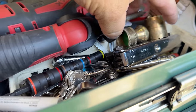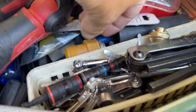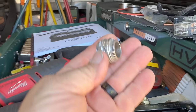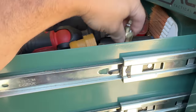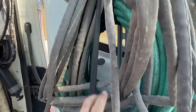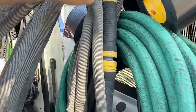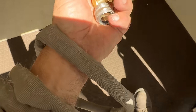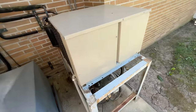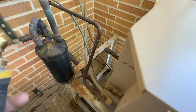Let's grab an adapter so we can clean that coil off. What I usually carry is a little adapter here — this allows you to get a garden hose adapter. I've been using this little gizmo here. While we're waiting on that to track, it does look like it's tracking time. He did say it had been running, so getting stuck in defrost is not the issue. He said yeah, it's been running, just not been keeping up — which is probably a clear indication it's packed full of crud on that coil. So let's go ahead and get that washed off, and we'll wash off some of the other ones too, so we're not back a day later for something else.